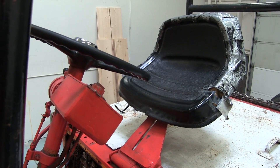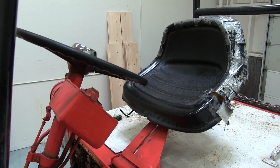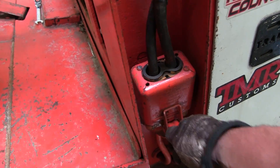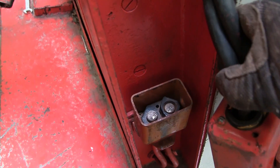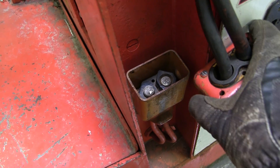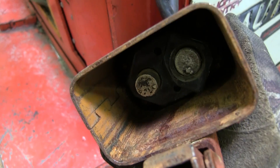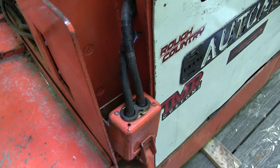I think it's pretty safe to say that a forklift should go in reverse. That's idiot check the first. Idiot check the second: reboot the thing. We've got a big monster lead acid battery underneath the seat and they gotta get connected up. Somebody's been in there trying to scrape them up to get better contact, but you can see the pitting. The thing is almost 60 years old. Right there is suspect. High resistance.